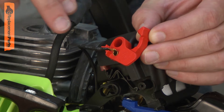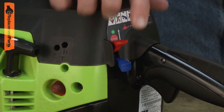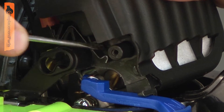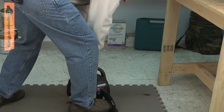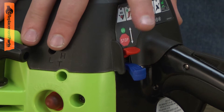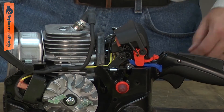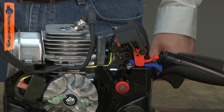It is a simple plastic lever that has a contact attached to it. When the saw is turned on, the lever pulls one of the two contacts in the kill circuit away from the other and holds it in place so the saw can be started and run. When you flip the lever to the off position, it brings the two contacts back together, which grounds out the ignition and stops the spark plug from firing, causing the engine to shut off.